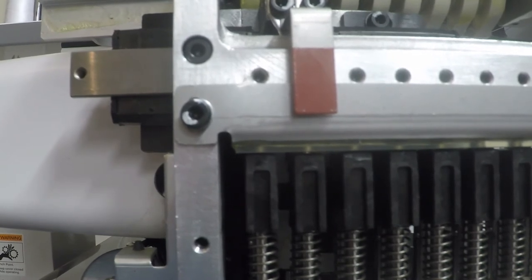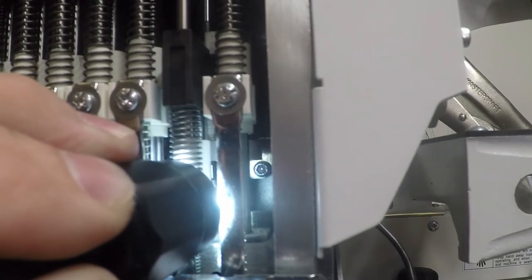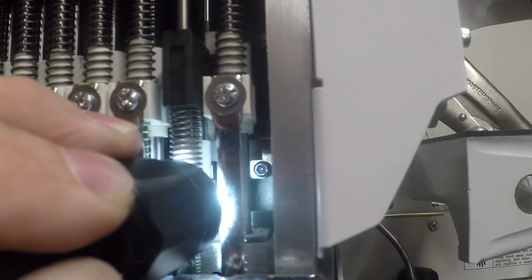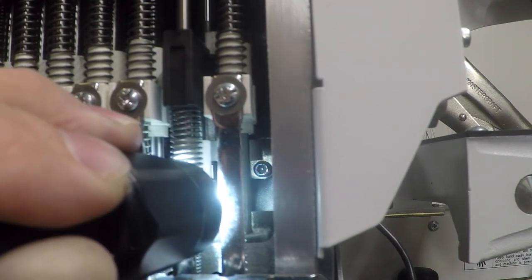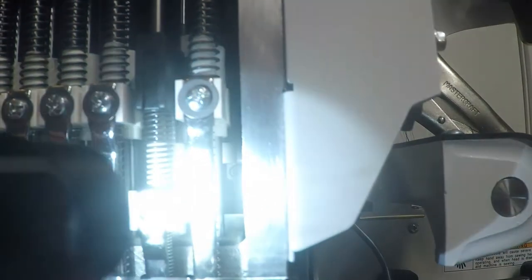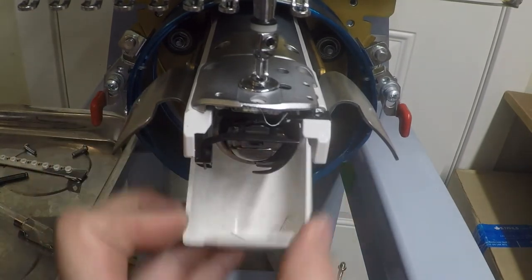After replacing the needle bar driver, you'll need to check the needle depth and jump timing. For needle depth timing, turn your degree wheel to 25 degrees with the machine at the second-to-last needle — needle eight on a nine-needle machine, or needle fourteen on a fifteen-needle machine. There's a little screw back and behind — take your three-millimeter allen key and loosen it counterclockwise to loosen the clamp on the needle depth jig. Then come down to where the hook is.